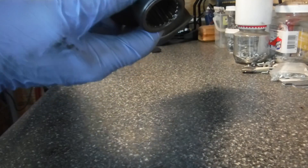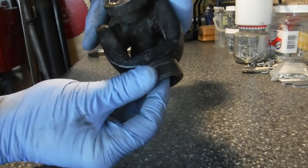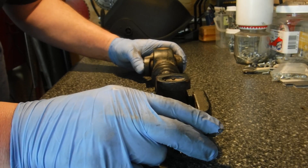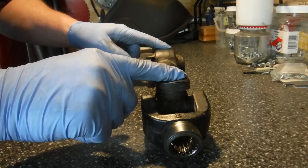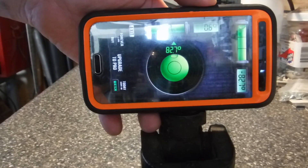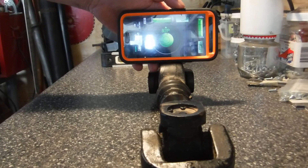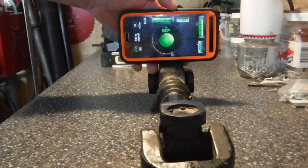There's your wear ring — this is a factory wear ring. You can see the wear mark around there already, but I can't feel any lip so it's not grooving right in, so it should still be good. Your drive shaft yokes are right flat on the surface. When they're talking about phasing, they're talking about these two being out just a touch — like the drive shaft is twisted. See the rock there. We're at point six on one side, zero point three on the other side — we're one degree off on the phase.